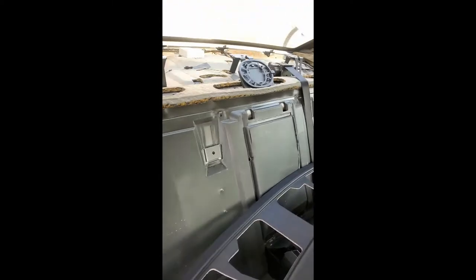So we got this put together — now we're going to slide it in the back and go ahead and install it. There you go — that piece is slid up and into place. It's all plugged in. We can test the operation. Seems to work right. So now we'll put the third brake light back in, plug it in, put the speakers in, plug them in, and start putting this panel back in.